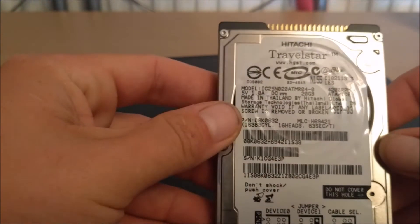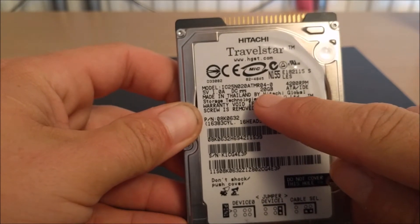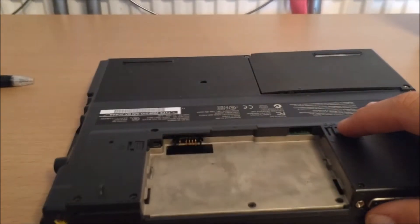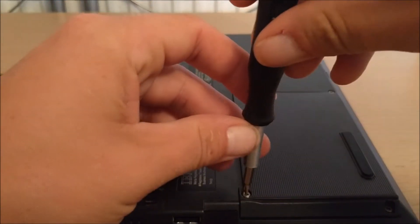Hello, my vacuum cleaner and newfound technology chums. So the ThinkPad - this morning I messaged a colleague who has an IDE 44 and 40 pin to USB adapter. I borrowed it before, so I took the hard drive into work. It's not the original - it's from September 2003 and it's 20 gigabytes. I copied over the Windows 98 Second Edition and original edition USB drivers in the hope that we can pop it back in and find them on the hard drive and install them.